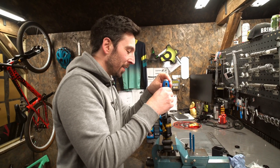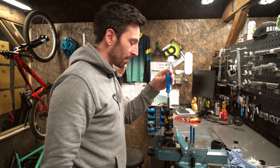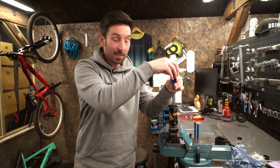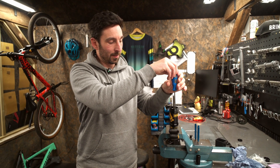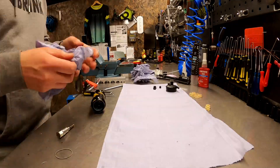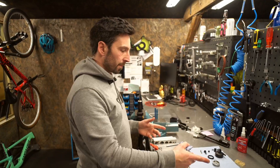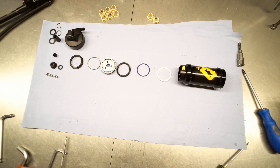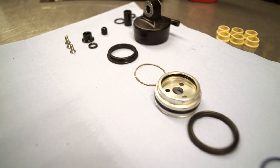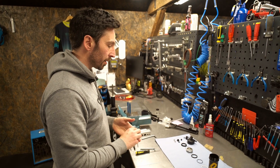Are you positive that the Ohlins is going to let the air out before this explodes? I couldn't get it to swap air backwards, so for those watching at home, nothing bad will happen. Coming up with the bolts? Yes. Good. So the air spring's off - that's the main parts of the air spring. Pretty simple system really, and similar to stuff we've seen in other videos with forks: there's a main air piston, a trapped volume of air, and a negative air spring as well. I'll go through and show you what those things are.